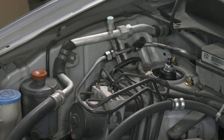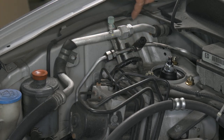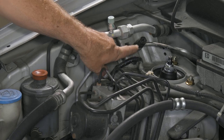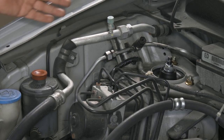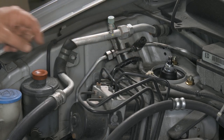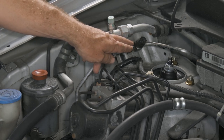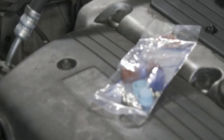So here we have a 2006 Honda Element. We have the high side, and there's a lot of oil buildup and grime right there. Typically, that means that the valve is leaking — the little Schrader is leaking inside there. So we're going to do a little preventative maintenance and go in and replace the Schrader valve on the high side here.